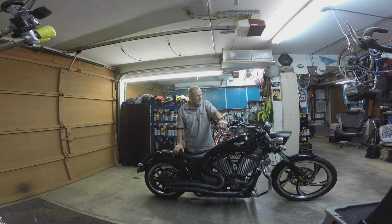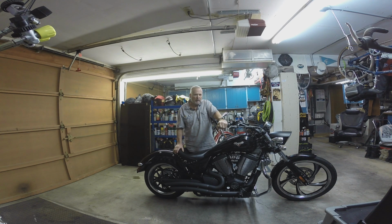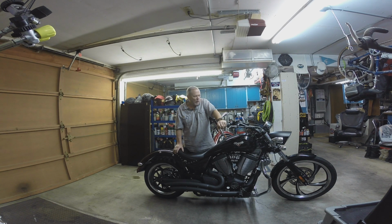I had it all hopped up by Ryland Voss near Des Moines, Iowa. The Vic shop. Took it over there on my way down to Bike Week in Daytona Beach. Stopped into Ryland's there for a couple days, and he worked it over and put it on his dyno. It's coming in pretty close to 100 foot-pounds of torque, and he did great work on it. He cut the airbox out of it. He put in the torque tubes. He put in a Lloyd's timing wheel, and he did quite a bit of tuning on it. Put a power commander on it and tuned each cylinder individually across the power bands. And I'll tell you, this thing is smoking fast.